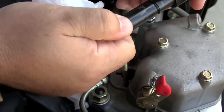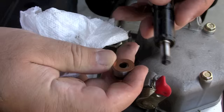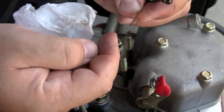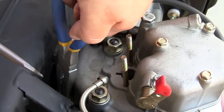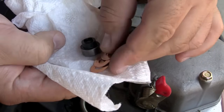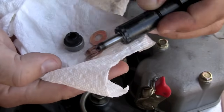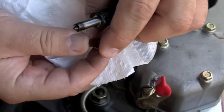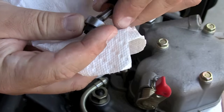Be very careful when you remove it. Sometimes what can be left behind are these little copper washers — very important. There are a few of them and you can easily drop one. If you don't notice it, recover it, or damage it, the distance that the fuel injector is protruding into the engine will make a huge difference in how your generator runs. In this case we have three of them. The factory has determined what the thickness of them should be and how far the fuel injector will protrude into the engine combustion chamber. By losing one and not replacing it, your generator will never run the same.